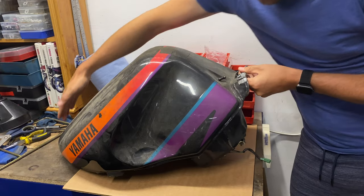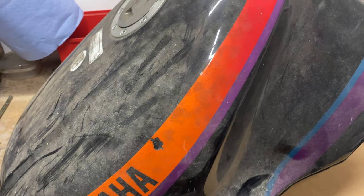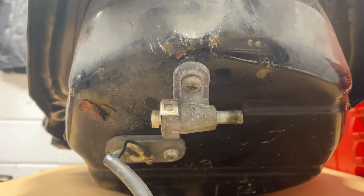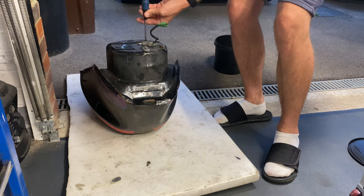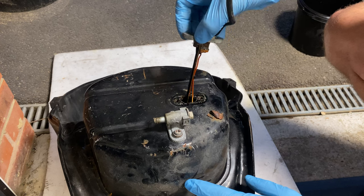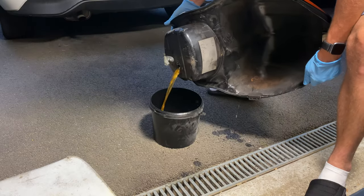Time to make a start on the tank. It could definitely do with a clean. Though I'm not going to repair the dings in the paintwork, I will be sorting the rusty bits and replacing the O-rings in the petcock and fuel level sender. I took a deep breath and had a look inside to check out what kind of soup I'd been brewing in there — I reckoned it was time to get that sorted.